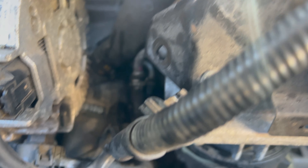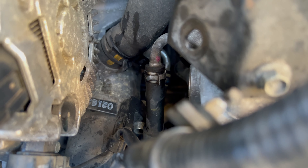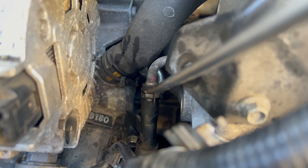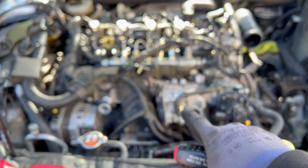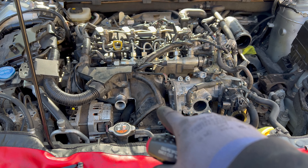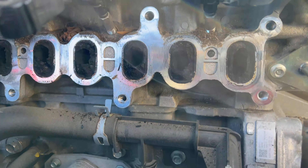Now I've turned it around — as you can see, I can pinch that together and slide it down on the rubber hose, and I can remove the rubber hose from the pipe. So that is 100% how you know if the intake manifold was ever removed on your Mazda 2.2 SkyActiv diesel. Here it is — see it for yourself.